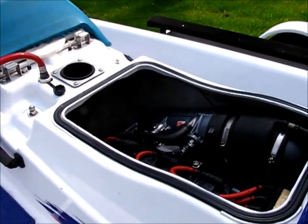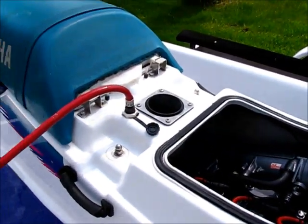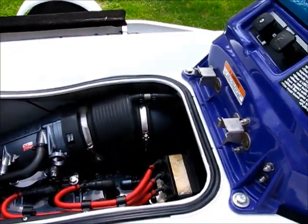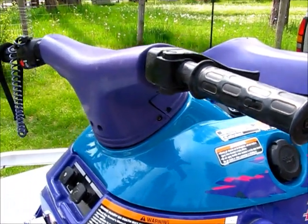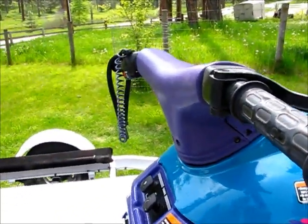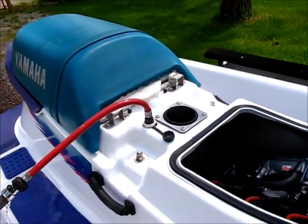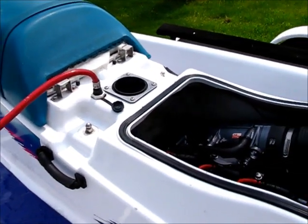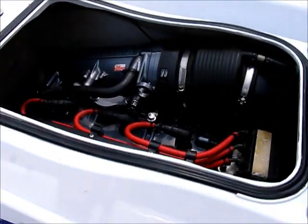I call it gurry — like they're kind of gurring around, but they still have a lot of power. So out of the water they sound really crisp, like a chainsaw. Once you get your engine put back together and you fire it up and put water to it, you can't just open the throttle up and assume it's going to run at nice high RPMs like a chainsaw — it won't. There's a rev limiter somewhere around 7,600 RPMs and it's going to start bogging out at that point. So if you fire it up and think something is wrong with the work you did — it won't rev up — it's not supposed to. These machines have a cool, one-of-a-kind sound; it's not like a Rotax.